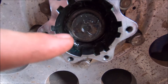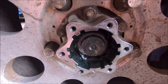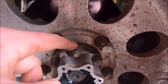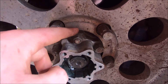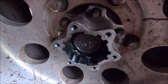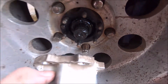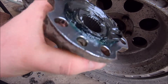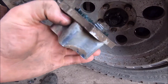With that circlip out from around the shaft, that allows you to undo this part of the hub and pull that off as well. Next, undo those 14mm bolts. They have little collets that go into the hub, so when you undo those bolts all the way, you'll probably need to give this a whack with a hammer to knock the collets out. Get all the nuts and collets out, and now we can pull this section of the hub off just like so. That's all lubed up with a bearing in there — that's your freewheeling hub, the part that locks your hub and shaft together.